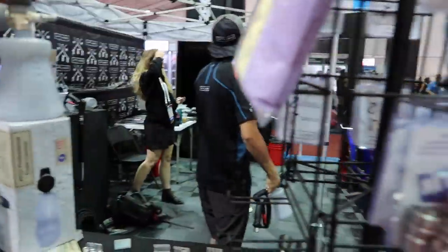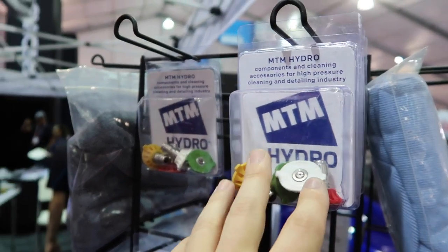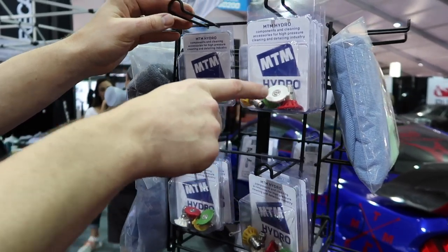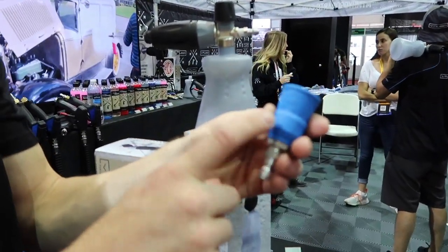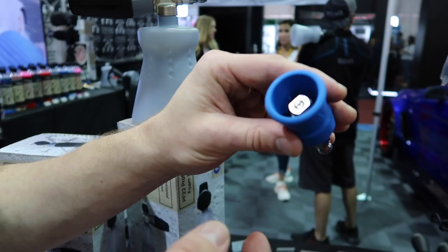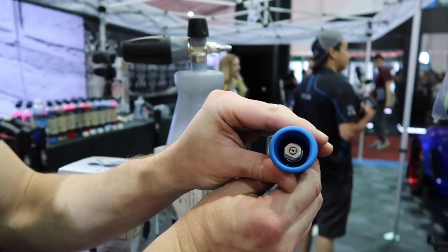That actually happened once with the foam cannon — I didn't put it all the way around and the whole cannon blew off. I was trying to teach my buddy how to use it and I looked like a dummy. So, the regular tips — the white one, the 40-degree. The 40 degree is what most people have. I also have the 25 for the wheels, just for a little more pressure. These are universal: across any industry, yellow is 15, green is 25, white is 40, and red is — don't touch it — like a laser. We're launching them with 25 and 40 degree. We pre-installed the nozzle, so this is fixed — it's not going to come out. It's the last nozzle you're going to use. There's no rust. It's easy to clean — if something blocks it, just use a pin and push it the other way, then tap it on the table.